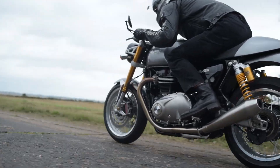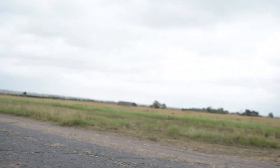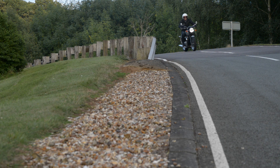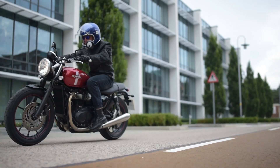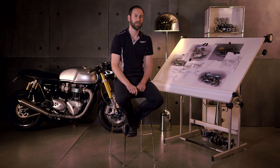One of the benefits of the ride-by-wire system is that we're able to tune the responsiveness of the engine in each of the different models — a slightly more responsive and sharper ride on the Thruxton and Thruxton R, and a more refined ride on the Bonneville T120. For the Street Twin, we were aiming for an engine package that would be rideable and accessible — still giving you an exciting ride but more manageable for newer and younger riders.